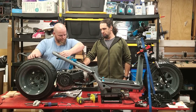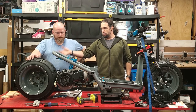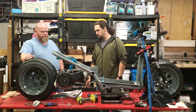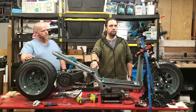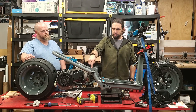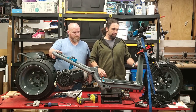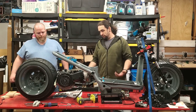All right, so the motor's partially mounted on there with the motor mount and everything. The last part will be the shock, but you always need to take your shock and there's a part of the bottom mount you need to grind off to actually fit on there. Sorry if the hyperlapse was a little shaky. We actually mounted it here so you can see us doing that work, and we had to switch this bracket around so it was in the right position. It was starting to get tippy with the motor on here, so we put straps on so it doesn't go anywhere. The motor's on there — if you look at it, it's starting to look much more like an actual bike.